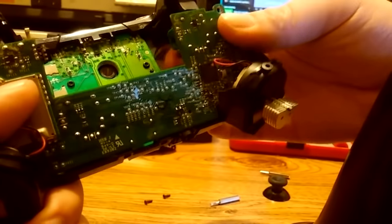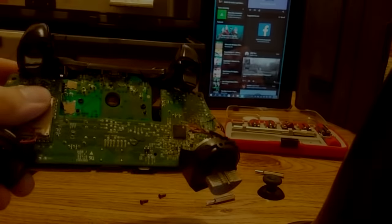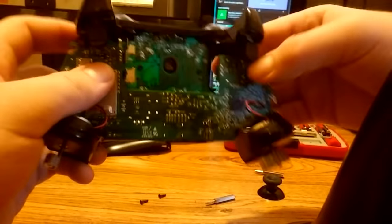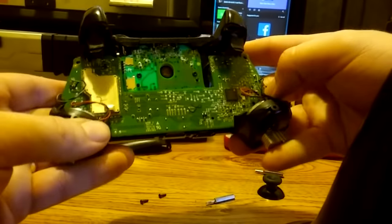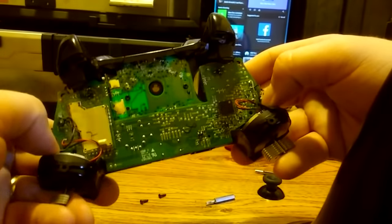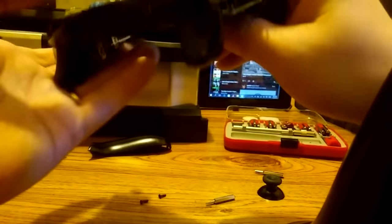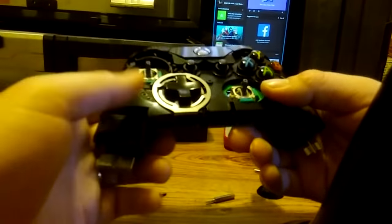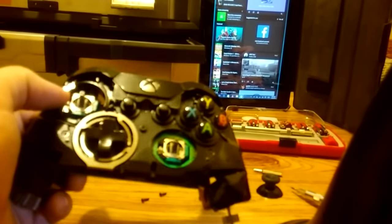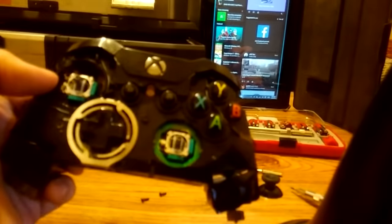This should resolve the issue and I should not be experiencing this problem anymore. Just move the joystick around a little bit — it's that easy. Remember to put the controller back correctly: push the motherboard back into place by lifting up on the two triggers and popping it back underneath. Put the two screws back in the bottom right and bottom left corners behind those motors and make sure they're secure. Then turn it back around and remove the tape — this is important, don't forget the tape. Remove the tape from the two motors and reassemble the controller the same way you took it apart. Make sure you test it before putting all the screws back in, in case you need to go back in and adjust it.